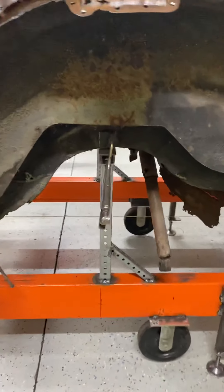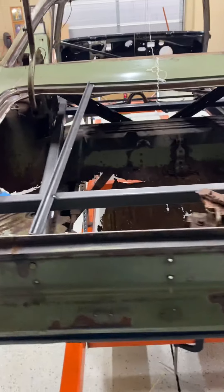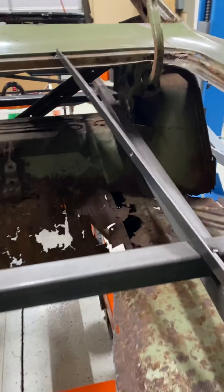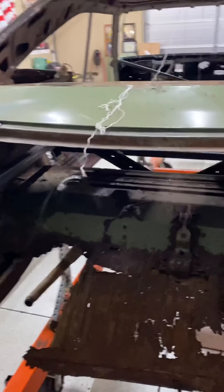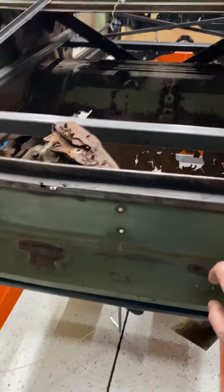I'll go around and show each one of the points. I'm purposely off of that torsion crossbar right now — I've got it set up three quarters of an inch off of the face of that washer on purpose. For now, I'm simply resting on the rear frame rails because I have nothing else to go off of on the whole back of this car — it's just completely shot. What I'll end up doing is building the whole bottom of the rear section on the frame jig and bringing it up and marrying it to the body.